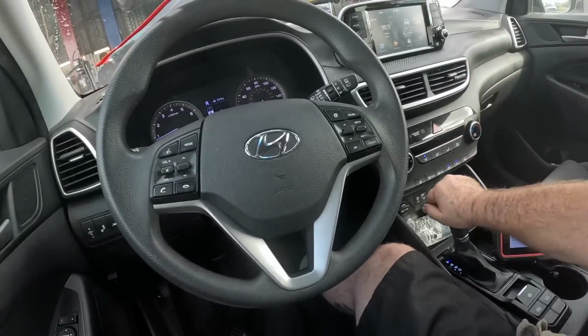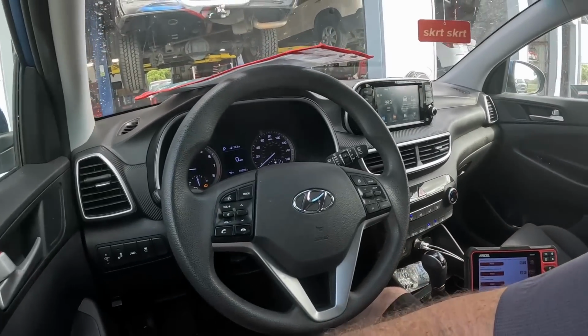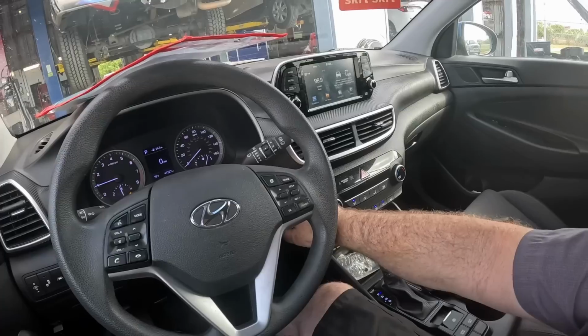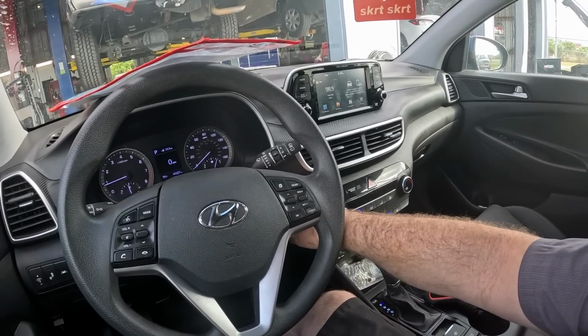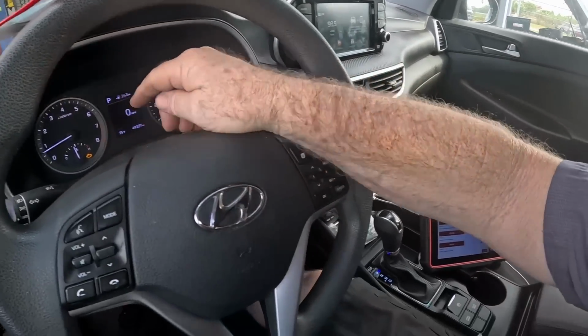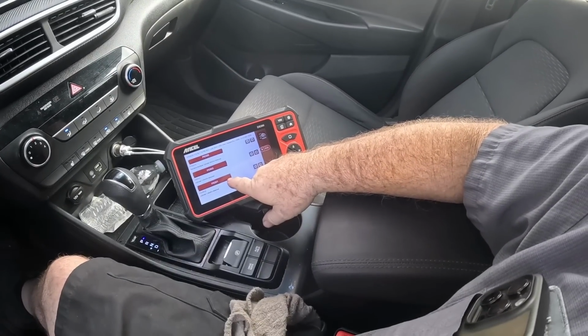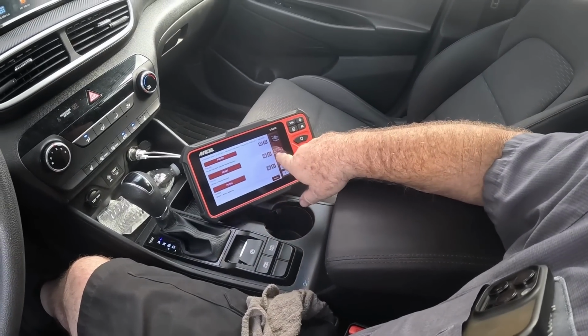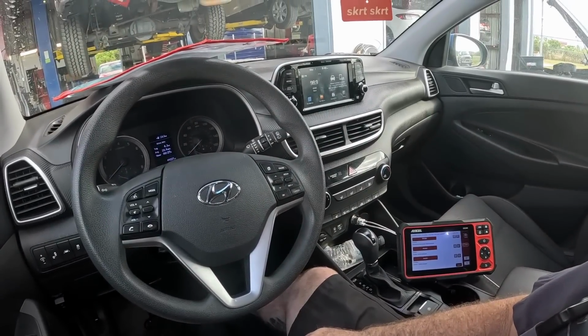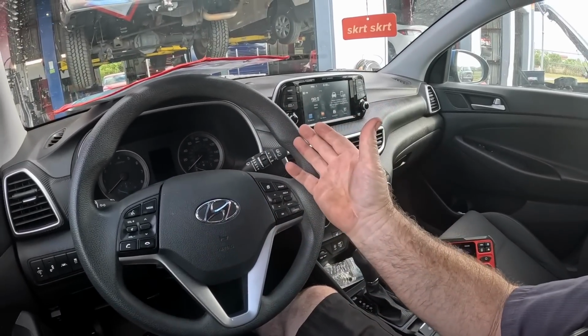It's the coil. That's why it feels like it has no power. It misfires. It just doesn't show you on the graph. I don't know, it's been a couple of vehicles now. It doesn't show you misfires while the thing's sitting there running around. I had a blinking check engine light. That had to be when it set the cylinder 1 code, but it never showed on the graph. In any event, we have a code that we didn't have before. Moving the coil moved the problem.